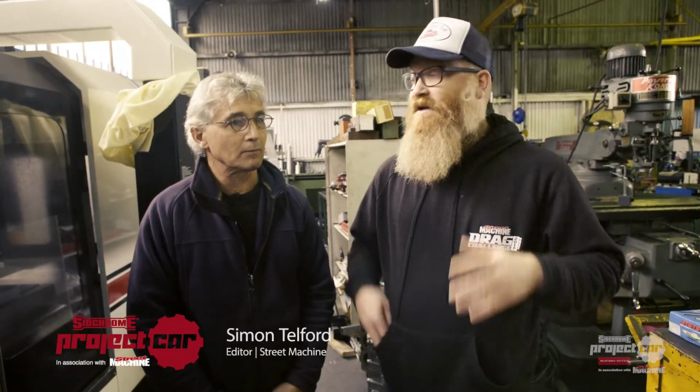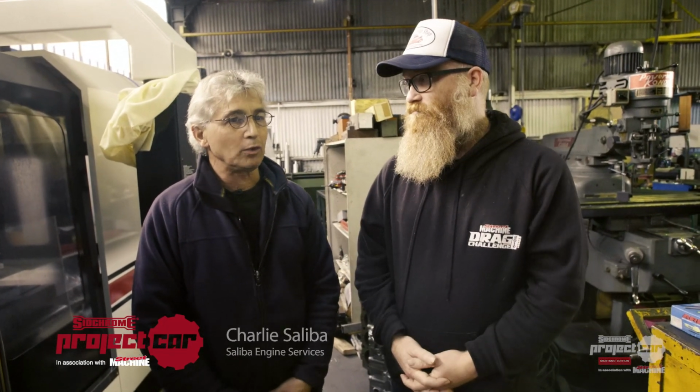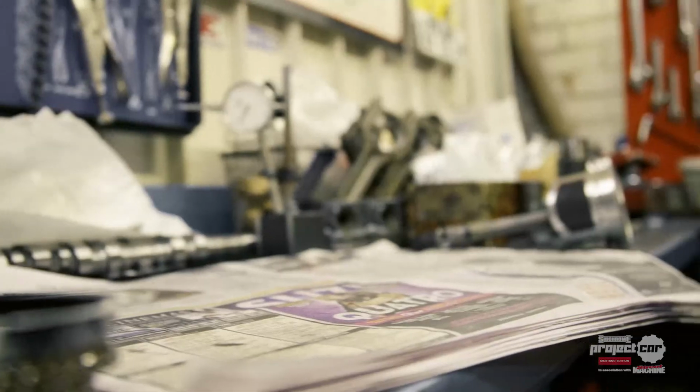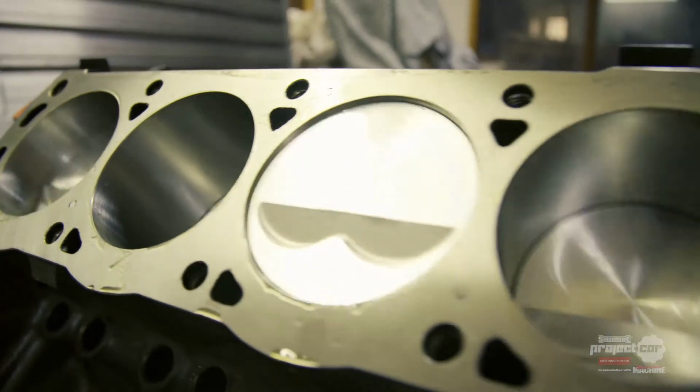All right, welcome to episode 2 of the Sidchrome Mustang project. Charlie, we've got that engine clean. What's the plan for this motor now? Okay, well the plan now is we crack test the block, make sure it's all sound. Then from there we select the pistons that we're going to use, what oversize we need to go, and then we can start on the machining basically.